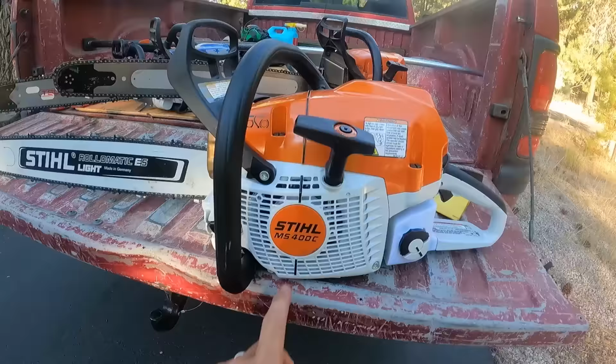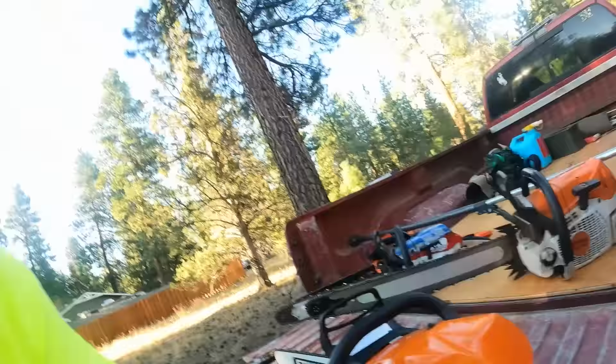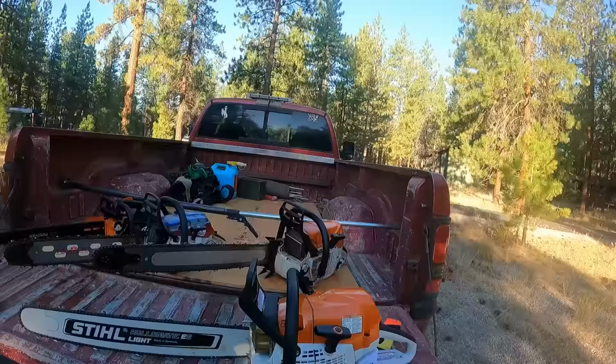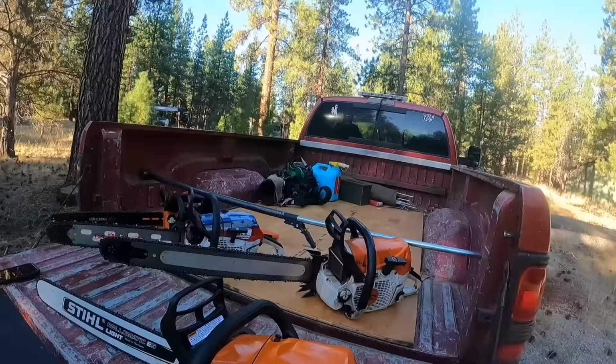It's M-tronic. You know, none of the new saws really have carburetors. I gotta say the M-tronic stuff when it first came out, at least with the 201s, had a lot of problems. Everybody liked the carbureted ones better because the computers were just real finicky. They didn't work that good. But a few years later, I really don't think they can be beat, honestly. I think the technology has just gotten so good. You don't have to mess with stuff like, for example, this is 4,000 feet elevation up here, a little higher elevation. For every 1,000 feet of elevation you gain, I just found out this from Gordy the other day, you lose 3% compression or like 3% power. So we're talking like 12% less power all the saws are going to have up here in general. But guys that cut at different elevations will tell you that they have to mess with the carburetors when they go from high to low in elevation. The M-tronic just takes care of all that for you.